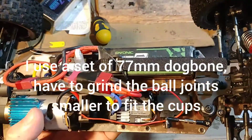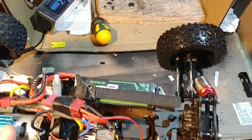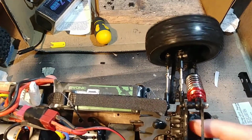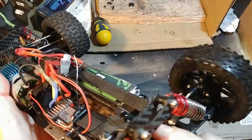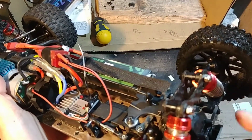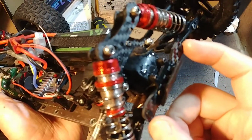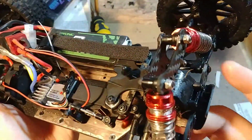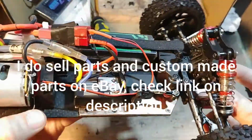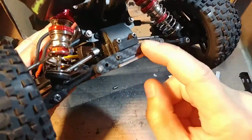The front is fine because it's converted into just a two-wheel drive, so no problem there. And even the shock tower, you can use the stock shock tower. Of course, I have carbon fiber with the reinforcement plate. Now, to expand the axle, I have to do these swing arm reinforcement. Expand it about 10 millimeter on each side, or 10.7. Everything is 10.7 millimeter. Same thing at the back. So of course the back piece and also the inner piece, I guess it's hard to see with that.